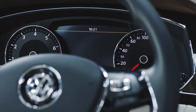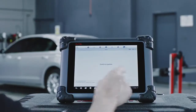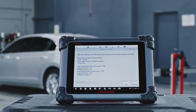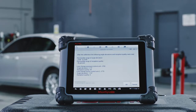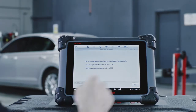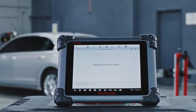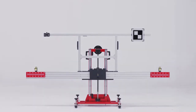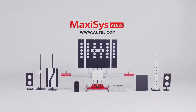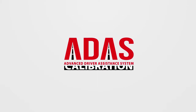Turn off the vehicle ignition. Wait 10 seconds, then turn the ignition on. Tap OK on the tablet display. The message will display that the control unit calibration is successful. The calibration of the Volkswagen lane change assistance system is completed. If you have any questions or concerns about this procedure, please contact our Autel support team. Thank you for watching this video and for being a valued Autel customer.